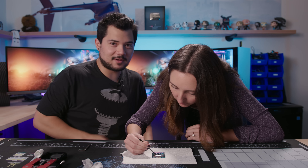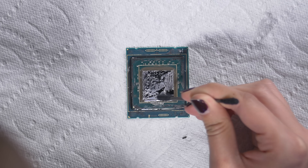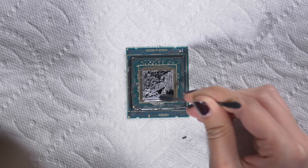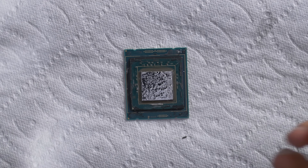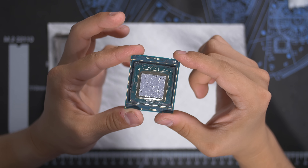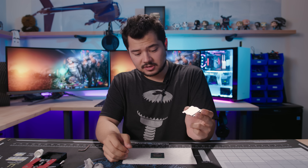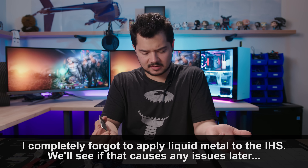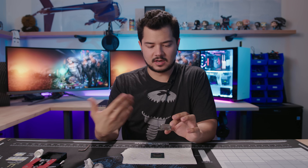Wifey Sauce has taken over — she saw what I was doing and was fascinated by it. Team effort, I suppose. Also, if the CPU ends up dying for some reason... I'm going to say that looks good for now. I'm going to do a close-up check to see if there's any liquid metal on the substrate where it shouldn't be. It should literally only ever be on the die, and it looks like we're good. Now I'm going to remount the IHS onto the substrate — we're not going to do a permanent seal, I don't have any silicone on me anyway.